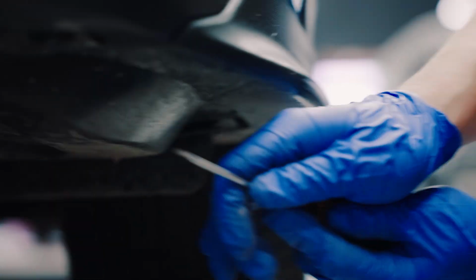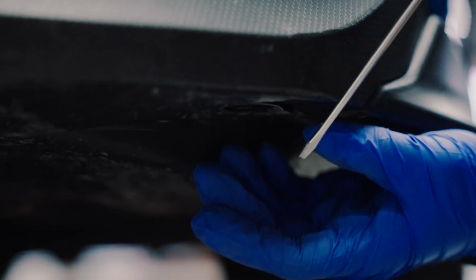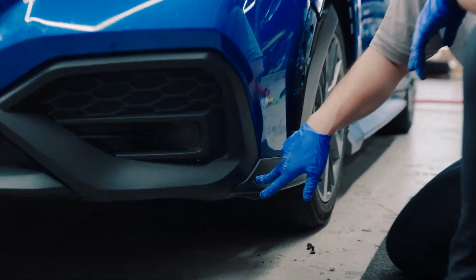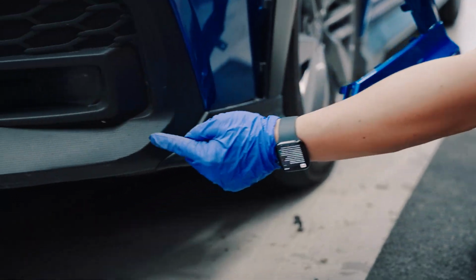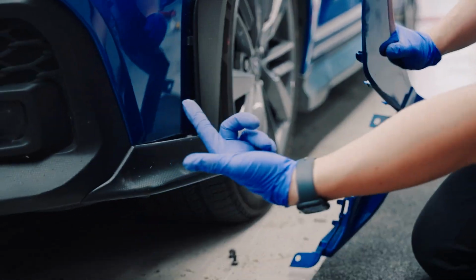I think I ate a good amount of dirt there. And there's one right here, the second one. Pull those 2 off and go ahead and start pulling from the bumper. And then once it gets here, it will get stuck because of the clips, which I'll show you on the flare, these 3 clips, they're really nudged inside. And this cover, the fog light bezel, actually goes through here. So you can't yank it out this way, you're gonna break something, right?